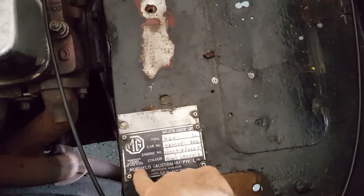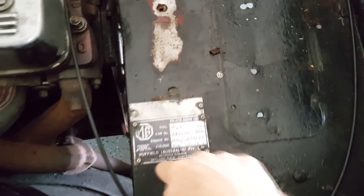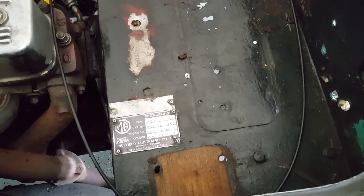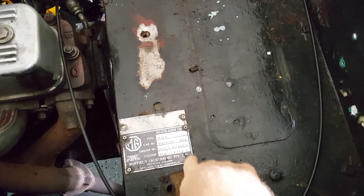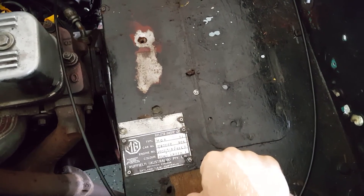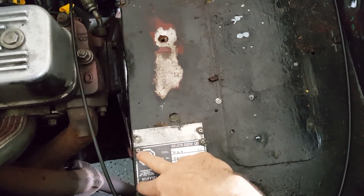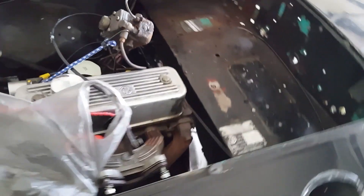What I've discovered, however, I'm a little bit worried about — we seem to have these rivets at the front. This one's come away. These rivets here are actually through the body into the chassis, so I'm going to have to drill out those rivets. As far as I'm aware it's just these front two rivets and not the back two, so I'm not actually going to be removing the whole plate. It may be I have to remove these ones as well, but I think I can get away with drilling out those. I'm hoping that's not going to be an issue down the track.